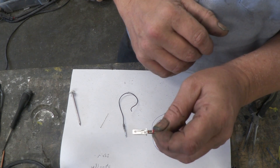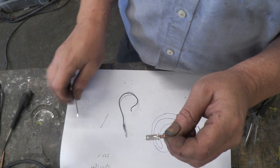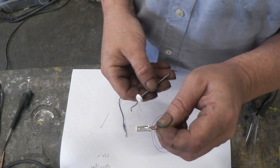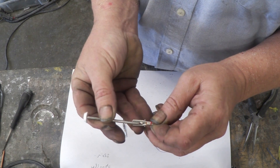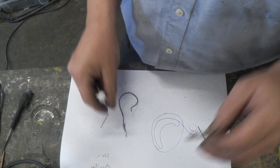If you want to remove one of those, what you've got to do is press that spring down. Pressing that spring down is pretty easy actually. One of the easiest ways is to get yourself some needle-nose pliers. If you don't have those, you can stick a nail in there and just twist it until that spring is pressed down. Then the whole thing will just pull out.